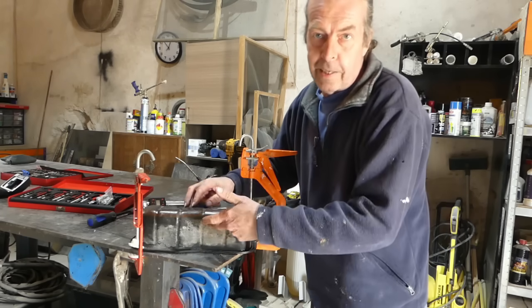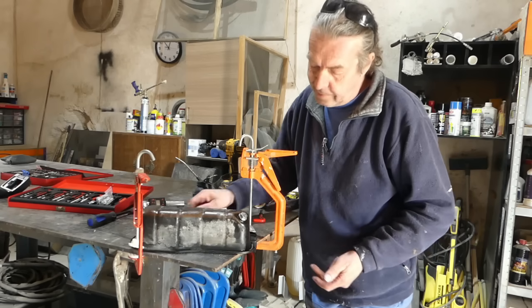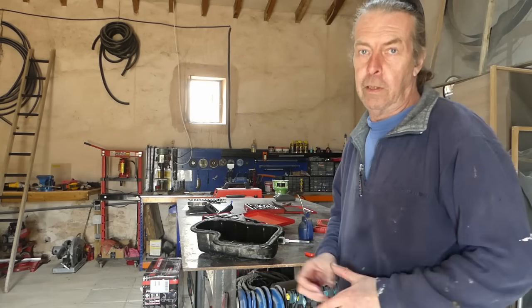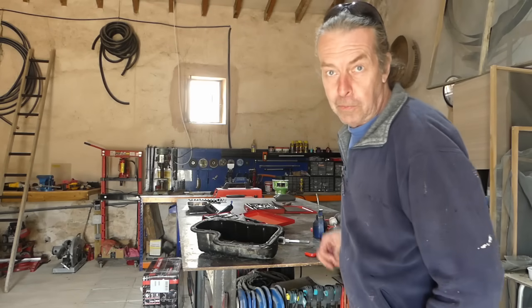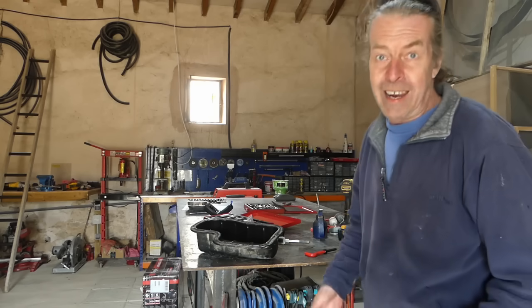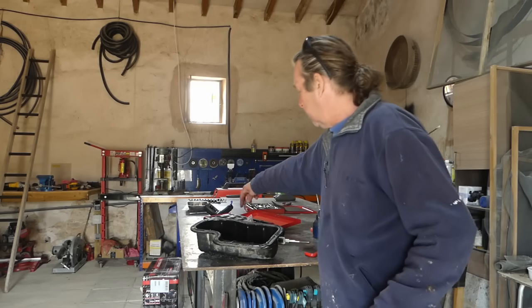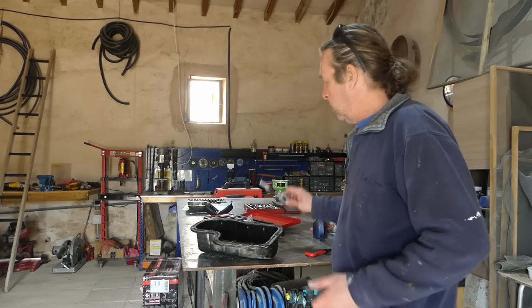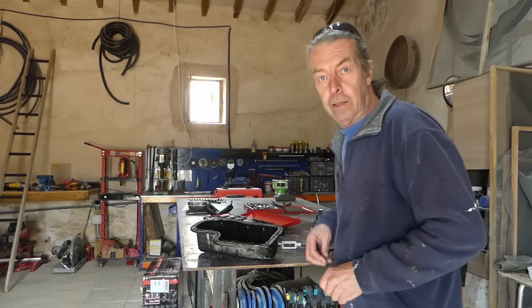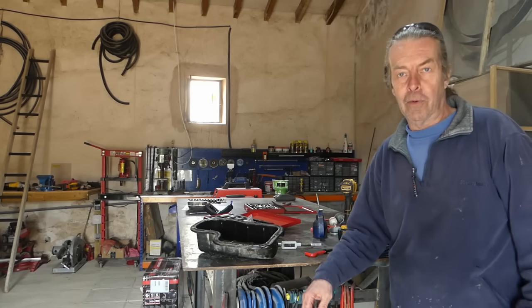Job done, fantastic! The hardest part of course was taking this off — and obviously you don't want to be cutting a thread into your oil pan when it's in place, in case you get bits of metal inside. Good as new. Quick recap: you've got your stripped thread, find a helicoil kit with the same size — M12 by 1.75 in this case. Get the drill of the right size in the kit, drill the hole through, use your tap to tap the new thread, then simply screw your helicoil insert in and you're done. Hope people found that helpful — if you did, give us a like and we'll see you on our next regular video.